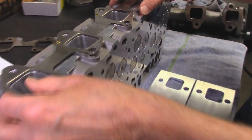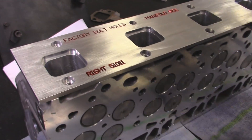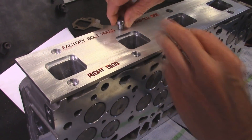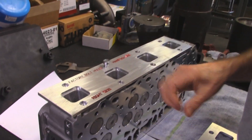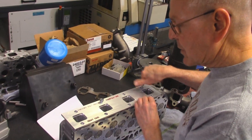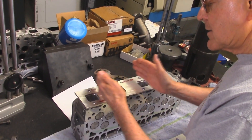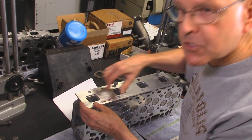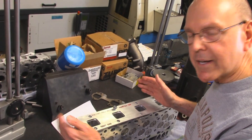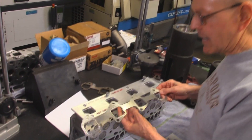To give you an idea — here's the truth plate, this is our manifold. When we mount up the truth plate, you can see that the manifold is slightly larger in all directions, but especially this way. As the manifold grows, it never hangs into the port. Whether it's cold or hot, it never hangs into the port and it slides across the face of our gasket.